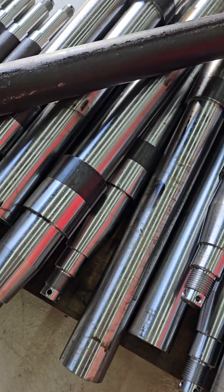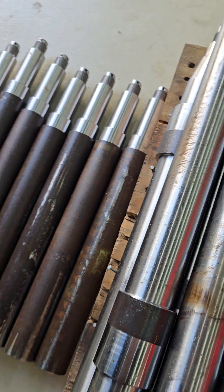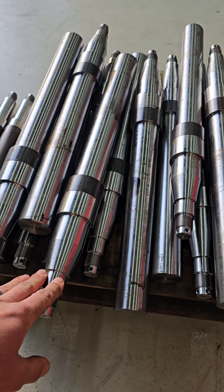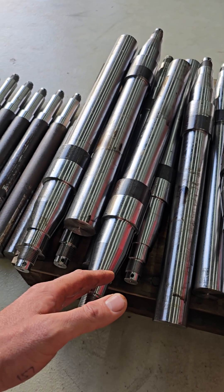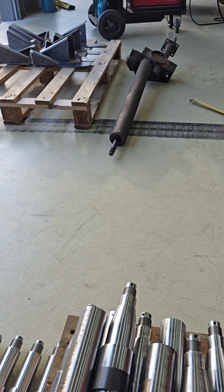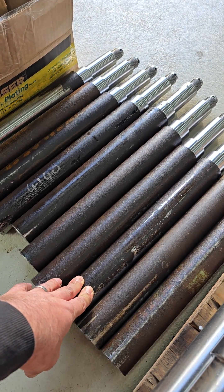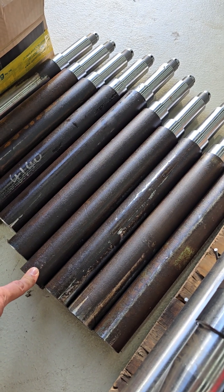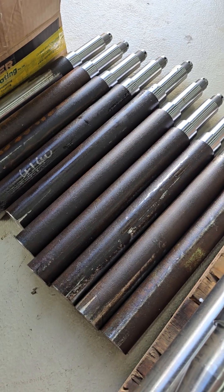We still do parallel, but we only install parallel in chromoly. These axles are manufactured from 4140 — a much more durable material. In fact this one's got 4140 written on it. This process is quite expensive. Our preference is to buy the arms from Track and install the two-tonne stub axle, but you're buying a lot of material and also have to upgrade your brake backing plates and hub drum. For customers trying to manage the total expense, what we do is remove the original stub axles — we cut them out — we prepare the asymmetric arm, clean it up, and then install them, but only in 4140. Same for Topaz — we only install 4140 stub axles in Topaz as well. We don't see a common failure in Topaz, but at the same time they're typically not abused as much as a lot of our T-Van customers.